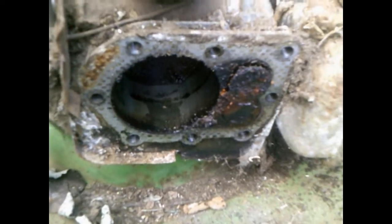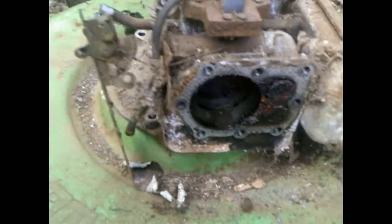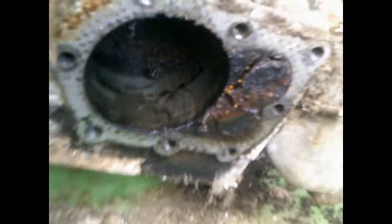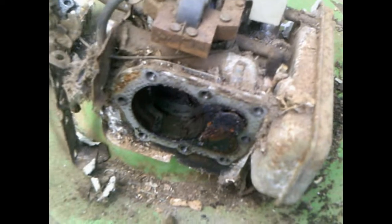Well, it has a stuck valve, like I figured. I have to get some rags and clean this up. Oh boy, that valve does not look good. Alright. Yeah, that's pretty bad. But wow. You probably can't see this on camera, but there's still cross hatching on the cylinder. That's pretty neat. Wow. Some light scoring, but this mower doesn't have that many hours on it. Bet you that intake valve's toast though. We'll clean it up a bit and we'll be back.